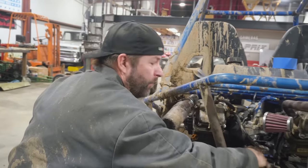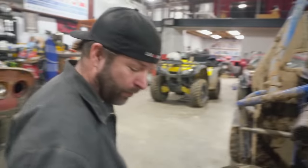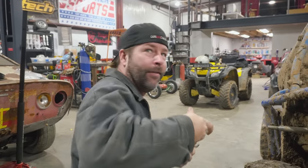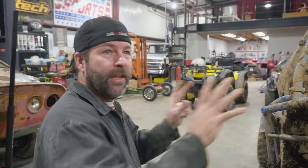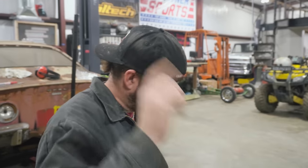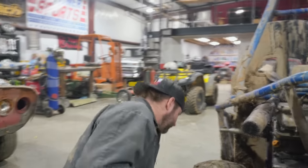So the other day, parts were just flying off this thing — literally. So we think that if we time one engine to where it's on the exhaust stroke and the other on the power stroke, it'll be better. If you get the power strokes hitting at the wrong time, it will probably cause a huge vibration. So we think if we put them evenly out, it'll probably even out the vibrations. We've been saying 180 out, but actually we've really been 360 out — because it's a four-stroke, meaning there's 720 degrees between each power stroke. Cut that in half: 360. Yeah, for two cylinders.